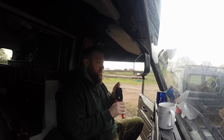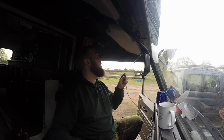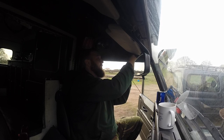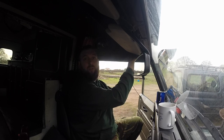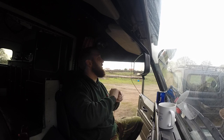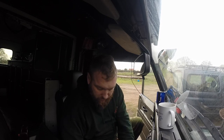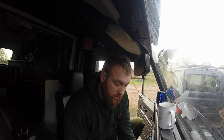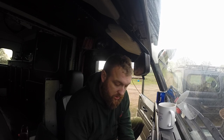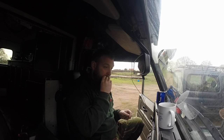Double crimp these, slightly stagger it. Connect that on there. When these connections are all done and it's working, I then go around with a bit of insulating tape around each one. So this one wants to be a male. Don't ever worry about this — so long as all the connections are good and everything's fused, it's an absolute doddle. It really is. Don't be scared off from it.